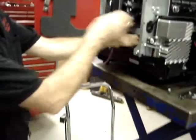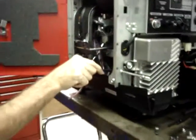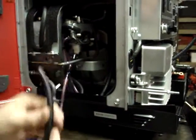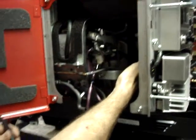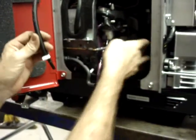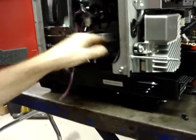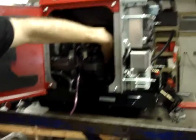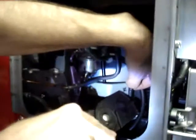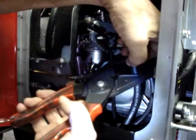And now we're going to go back to the generator. What I like to do is take the large quarter inch hose that comes up and hide the adapter right here, even with the airbox mount. That way you've got the clamps holding the hose away from the airbox mount. So where this comes up in radiuses, I'll mark it right where it's even with this bracket on the airbox, and I'll cut it here.